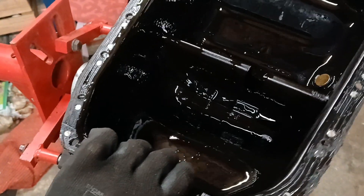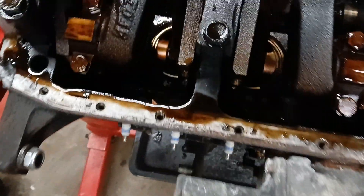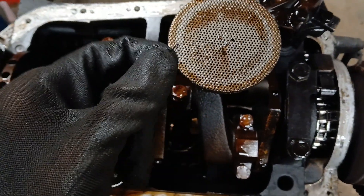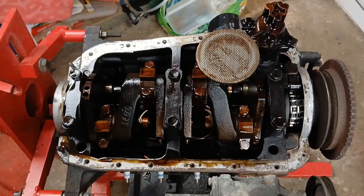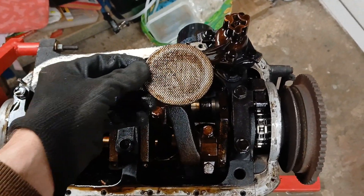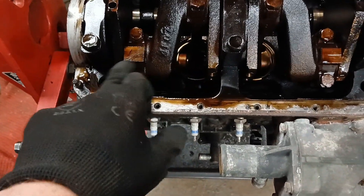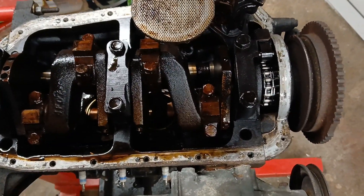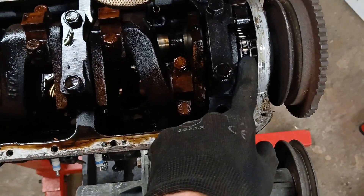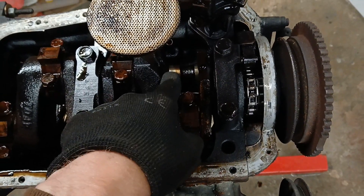I'm going to have a little rummage around in there to see if I can find any metal. It looks all right, I'm going to say. Looks like a bit of silicone so that might be all right anyway. Nothing terrible in the pickup tube — not massive chunks or anything. I wasn't really expecting it to be, as this thing was in use before it got swapped over for the Trofeo. It's unfair to really pinpoint on a car that's done 120-odd thousand miles. The chains are looking in really nice condition, actually.